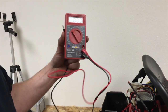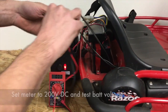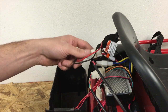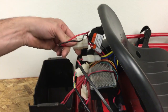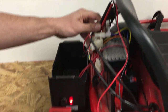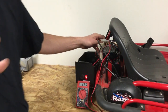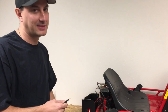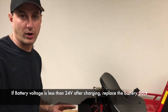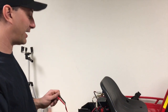You're going to get your meter — which we sell on our website wildscooterparts.com — and check the voltage of the batteries first. I'm going to put the two prongs in the connector, red and black going to the battery. Make sure you don't confuse it with the motor connector that has blue, yellow, red, and black — this one is red and black on both sides. On the meter we have 26.5 volts, that's fine. Before you start, make sure the batteries are fully charged — charge overnight. If you have anything less than 23 volts there's something wrong with the batteries; they should always be over 24 on a full charge. The machine will not run below about 21.5 volts. Ours are at 26, so batteries are not the problem — we've knocked that out of the equation.